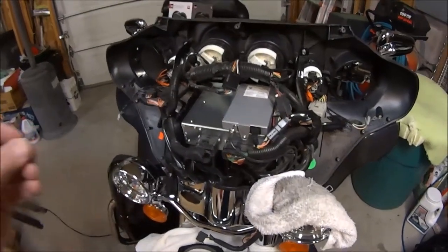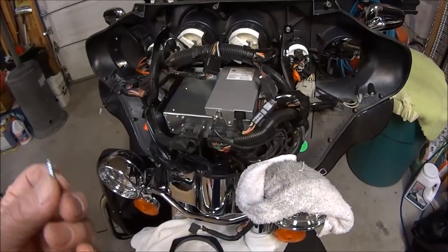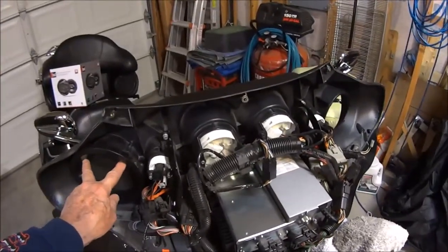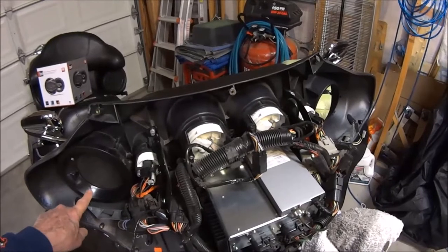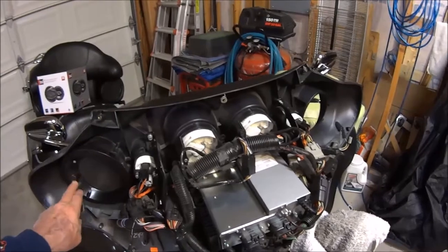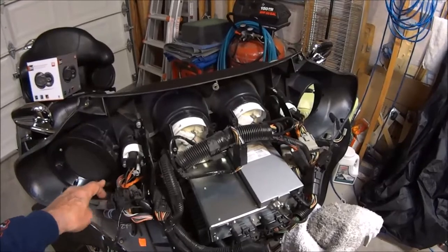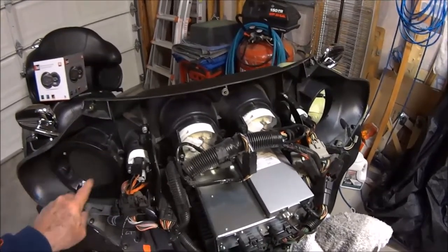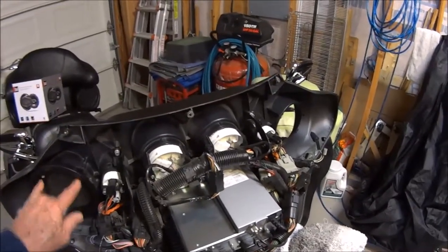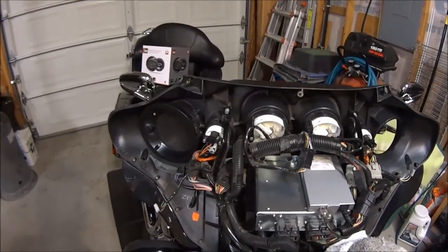The original screw that came with the kit wasn't strong enough, or wide enough, to really feel like it was going to mount to the fairing itself and hold in place without coming loose. But I did use red Loctite with all of them. It's only 3 holes. Some kits had 4, but I only had 3 on this, and it's all you ever needed. I am pointing out where the 2 top ones are and the bottom there. It is a pretty simple installation.